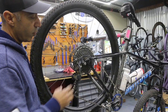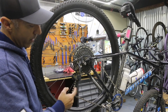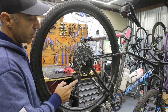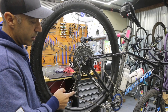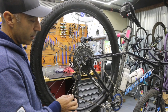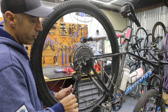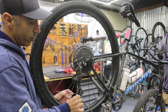The other component for a 1x system is your rear derailleur. Not only are we running a long cage with possibly bigger diameter pulley wheels to accommodate our larger cassette, but the derailleur itself has what they call a clutch — Shimano uses that term, and SRAM as well. It's going to allow this arm to stay nice and tensioned, very tight. If I turn this clutch off, it functions like a regular derailleur would on a non-1x system. I can push this very easily and get a little bit of chain slap. As soon as I flip the switch up, this gets much harder to push.